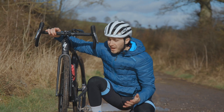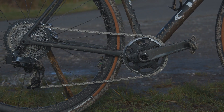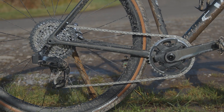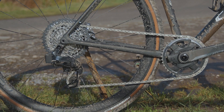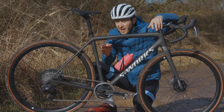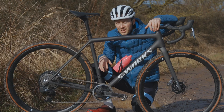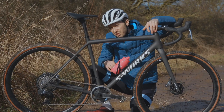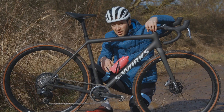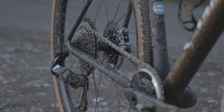For a privateer, you can get to the end of the race with the wheels still turning. SRAM's Red eTap AXS Explore groupset has a lot going for it, and this Explore model is my favourite yet. The 10-to-44 tooth cassette at the back is really nicely spaced with no silly jumps, so the feeling at the pedals is quite nice. Combine it with the 40-tooth chainring and there's a gear for just about any occasion. The 40-10 combination creates a gear ratio of about 53-13, which lets you push along on the flat, and the 40-44 will get you up anything.